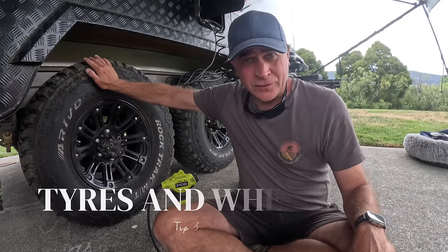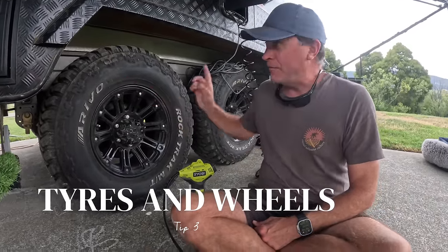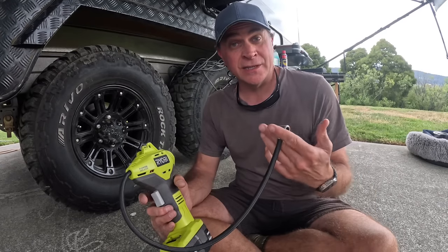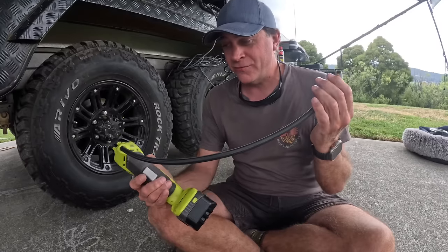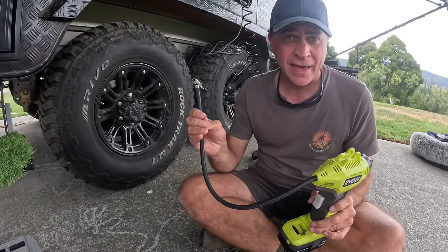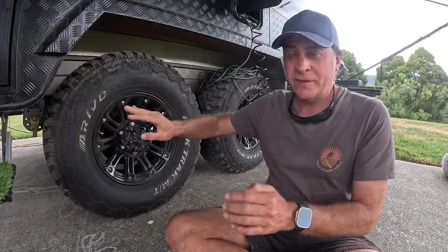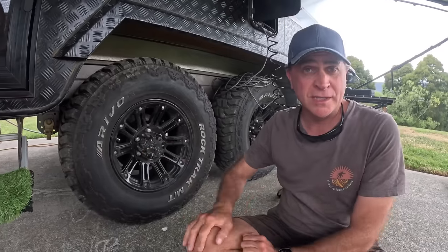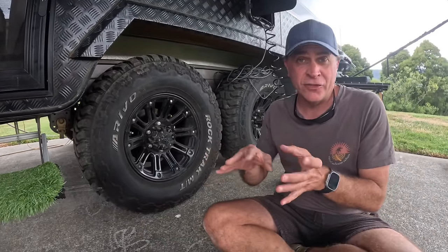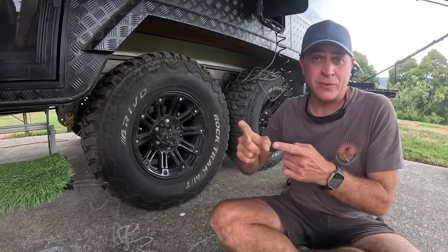Your tyres and your wheels. We're really lucky in this caravan — we've got a compressor in the van for the airbag so we can use that to blow up our tyres. Before we had this system we had a little portable compressor. You don't need to spend thousands of dollars getting a compressor installed — you can get one from Bunnings for about $90. They're a bit slow but they do the trick. When driving on bitumen we inflate to 50 psi, and we check that once every couple of weeks. If we're going on dirt roads we drop it down to somewhere between 30-35 psi, because the softer the pressure the more surface area on the tyre and the less chance of getting bogged.